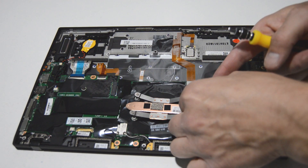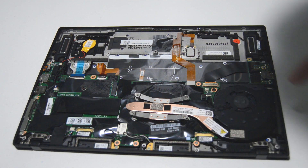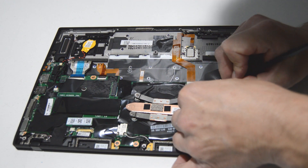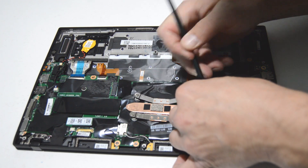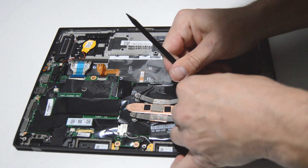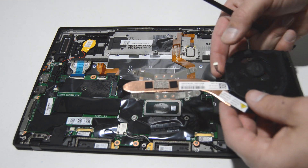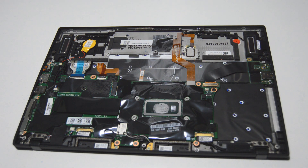For the fan, there's just a little tiny connector here. We're going to gently pull and try to work that connector out. It definitely helps to have a spudger or some other kind of precision tool to get in there and loosen some of these tiny connectors. Generally just work it back and forth while applying a little bit of pulling tension — not too much, because you don't want to damage it — and you'll be able to get that tiny connector out.